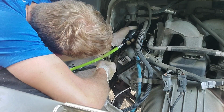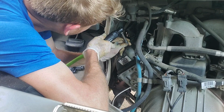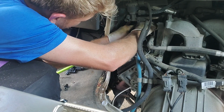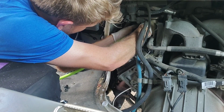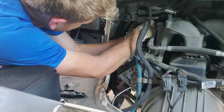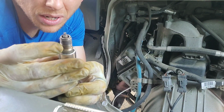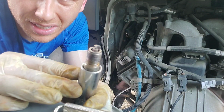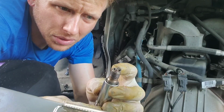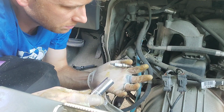So I like tools that give me good access to stuff. It's kind of one of my things I just like to buy. Those kind of tools. I'll show you a roll cart tour one day. So I don't mind removing spark plugs with tools. So I think he had wire wheeled it off yesterday, but yeah, you can see it's been cleaned. He cleaned this just to kind of confirm that the oil fouling was contributing to the problem. But this was all caked and nasty yesterday. Massive amount of grease on there.